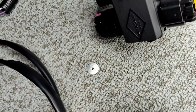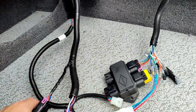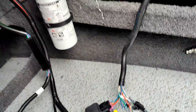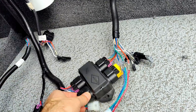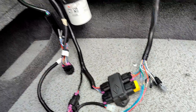The wire colors are self-explanatory — they match up. This goes into here. Then there's another plug coming from the same harness from the MCU: one plug went to your head unit, this plug goes to the J-box. The complication I had was on my tachometer up here — it has another one of those plugs. This connector is male, and in here it's also male, so I had to order a female adapter so I can plug it in and get my gauges back, mainly the tachometer.